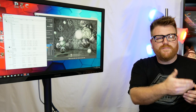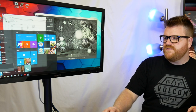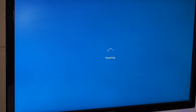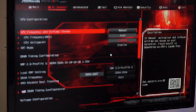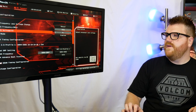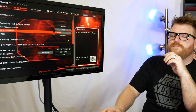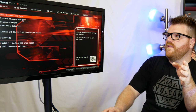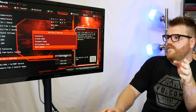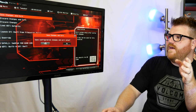Getting some of those cores out really helps with temperature, so you can overclock to the bleeding edge on a four-core chip more easily. Let's put this to a reasonable overclock. Four gigahertz is totally possible, and I'm going to set it to 1.4 volts — pretty much the maximum you'd want to hit in one of these. We'll set the fan speed to performance mode, save, and do another Cinebench run to compare and see if it's really even worth it to push your chip to the brink.